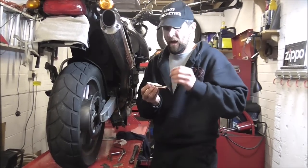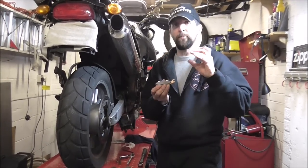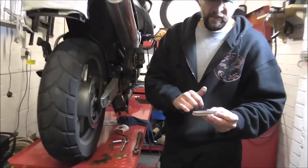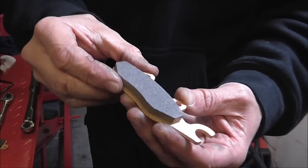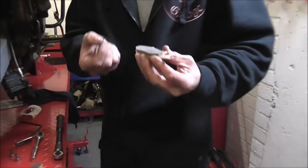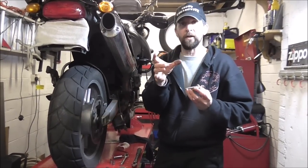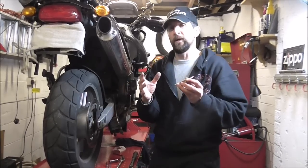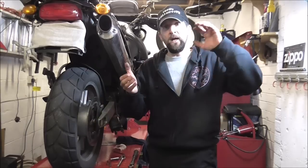It simply means to take a powdered compound — a dry powder of some kind, usually a metallic compound — and press it together under extreme pressure and heat until it fuses together just short of the melting point. So with sintered copper, this is literally powdered copper. They take powdered shredded copper dust plus a few other compounds and bond it together under great pressure and make a copper puck. It doesn't actually melt or fuse itself, it doesn't become a liquid or flow. It's a dry compound pressed together — not really any different to taking dusty snow and pressing it together to make a really hard snowball.